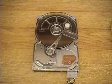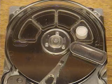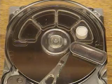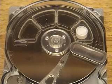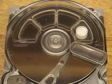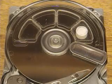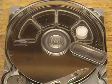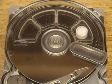I'll spin it up now and we'll see the demo. The disk starts up with a certain initialization procedure, and then it will go into this test demo. This is not what your normal computer hard drive would do when it was running, but it's going to demonstrate seeking different tracks. I want to emphasize that it accurately locks onto a track each time. Now the disk has spun up, and you can see it's doing one-track seeks — moving onto one track at a time, locking on and moving on to the next one.